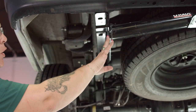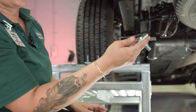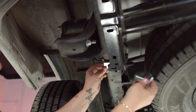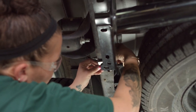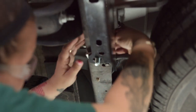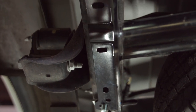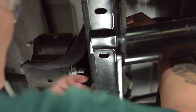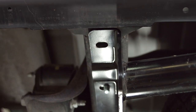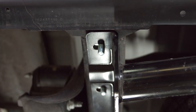This hitch does require that spacers are put in between the frame and the hitch. So doing that, we're gonna take the spacer that is on the bolt and the spacer that goes in between, and just reach up and line them up and drop your bolt down. You'll repeat the process, then go ahead and do the same thing on the passenger side.